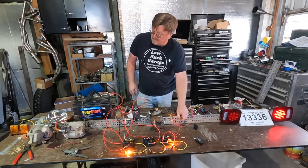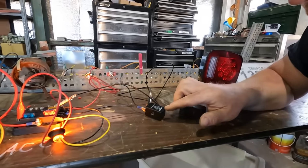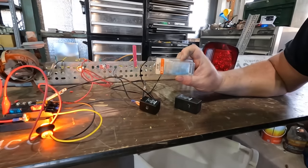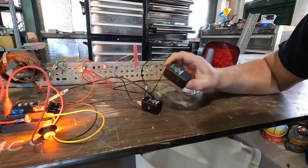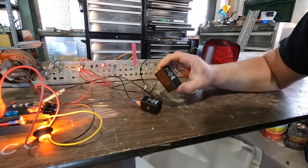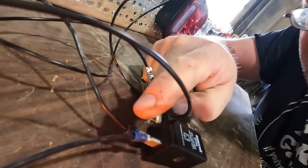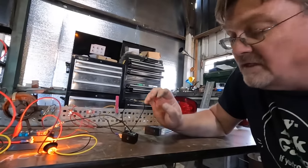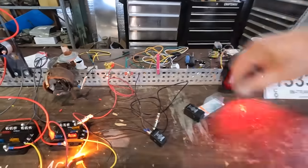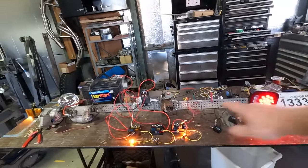Now I'm going to try my fancy new one and see if it works with two lights. These lights over here are side marker lights from a trailer with an incandescent bulb, not an LED. If I wanted to use LEDs on the front, would that work? Hooking those up — we're back to just on again. They don't draw enough juice to make it flash. It's bugging me that I can't get this to work when they say they're LED compatible. So I went and bought an off-the-shelf EP34 that says it's LED compatible — it's a smaller one for between two and six lamps. Physical size has a lot to do with the electrical carrying capacity. The only one they had was a three-wire hookup with power in, load out, and an E-terminal for ground. This flasher works fine — I've got a setup that works with my LED rear light, my LED front light, blinking properly, with just one extra wire.